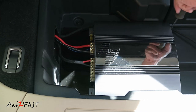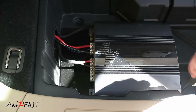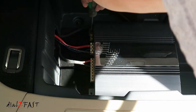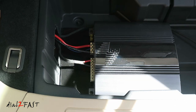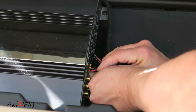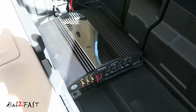Now I should mention, this is actually an older amp that I've had for many years — it's a fairly good amp and I didn't find a need to buy a new one, so that's why I'm reusing it. Before your install, you can choose whatever amplifier you like, and the connections I'm showing you will be the same for all amplifiers. If the amplifier you have does not have a high-to-low converter input, you can purchase a line level converter — I'll include the link below. Here I'm connecting the two pairs of high-level speaker wire from the Bose amplifier to the high-to-low level converter on the amplifier, so the amplifier will get the audio signal from these two pairs of wires.